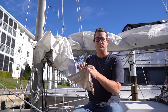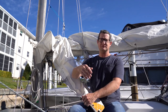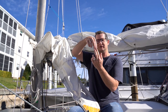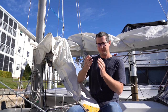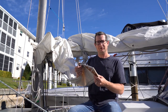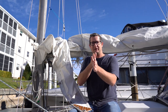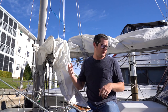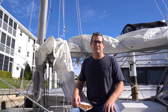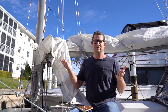We're on our third set of slides at this point and the track is starting to get a little worn. It's made of several pieces butted together and where they're butted together they don't line up perfectly anymore. I've done my best to file it a little bit but the slides hang up. On this boat we can't raise or lower the main unless we're within about 5 degrees of the wind, which is fine for lake sailing and coastal stuff, but we really want to be able to lower or reef the main in conditions not straight into the wind.